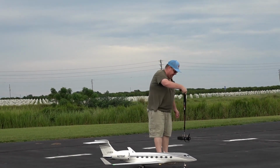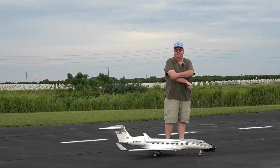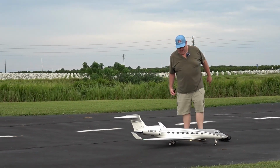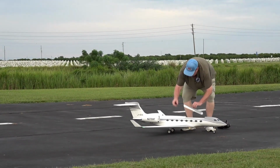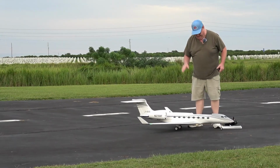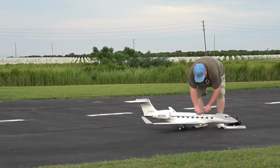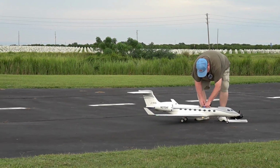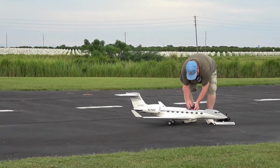Yeah, if I wasn't fighting that cross breeze, having to power through this, I could have had my wheels down a little further down and not gotten off the runway. Same thing from the other direction, but when that wind's directly across the runway, you've got to have more power. Speed, power equals stability.